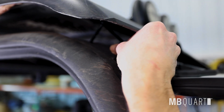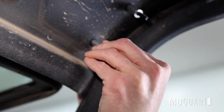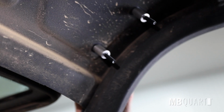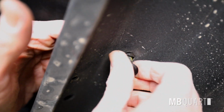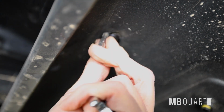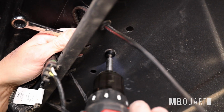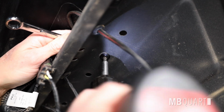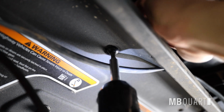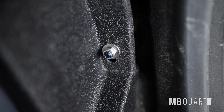Install mounting bracket on driver and passenger side roll cage. Install an aluminum spacer and plastic retainer washer onto each M6 bolt on the mounting bracket on the driver and passenger side. Reinstall the 3 T40 Torx bolts and 15mm nuts previously removed from between the roof and roll cage support. Install the visor using M6 washers and M6 nylock nuts. This may require a helping hand from a friend.